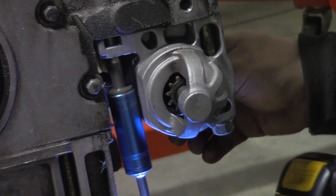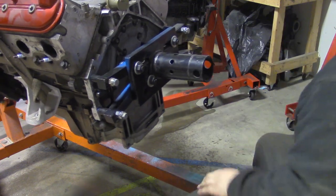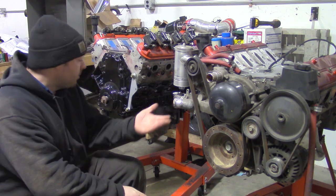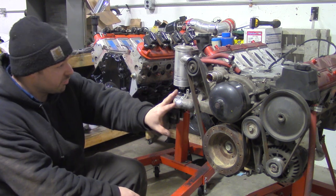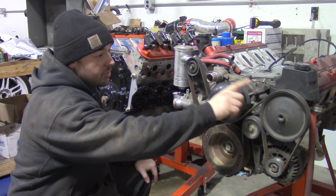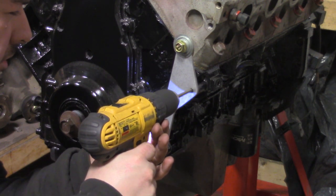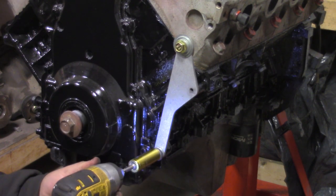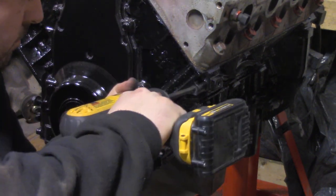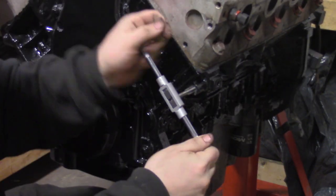Remove the starter. Now attach the arms for the engine stand and slide the engine stand onto the adapter. Now that I've got both motors set up on engine stands, I'm going to swap all the accessories from this one to this one — with one exception: this power steering pump is blown, so I'm going to replace it with a new one. A hole must be drilled and tapped to mount car accessories on a truck motor. I use a template to make sure the hole is in the right place, then expand the pilot hole and tap to M10 by 1.5.